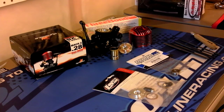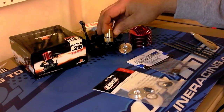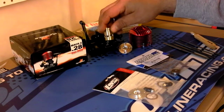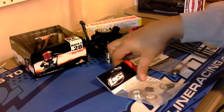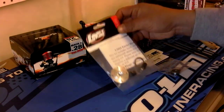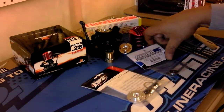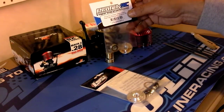I'm going to do some work on the sleeve, do some modifying on the boost ports and the transfer ports, polish drop. I'm also going to add the turbo head conversion kit and install the front engine bearing — the Speed ceramic bearing.